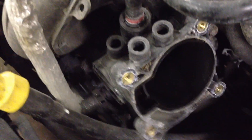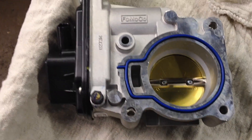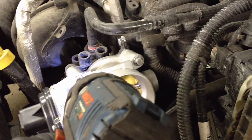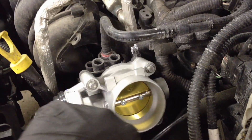Get the electrical connector off and remove the throttle body. Take some brake cleaner and a rag and clean that sealing surface — these electronic throttle body systems are very sensitive to any air leaks. The new one comes with a gasket already built in, fully complete. Once it's all cleaned up, you can bolt it back on at 89 inch-pounds in a crisscross pattern.